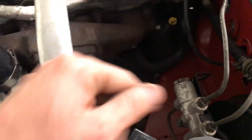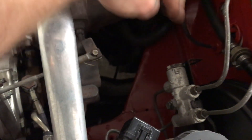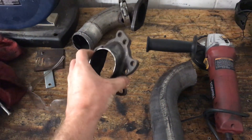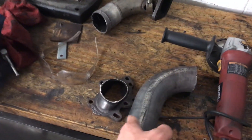Right now I'm cutting up and remaking my downpipe because my exhaust will not fit. There are two reasons: the Turbo II bell housing is bigger than the RX-7 bell housing on the transmission tunnel, and I patched this hole right here — this red piece down here. If you've been following the build, I cut that whole shelf off before, then put a new piece of metal on it and fixed it up. So I need to make a new downpipe. This was my old downpipe — these three pieces. I cut the flange off that bolts to the turbo and I have this downpipe flange. I'm going to cut it somewhere around here to tighten up the angle and make it drop faster, then remake the whole exhaust.